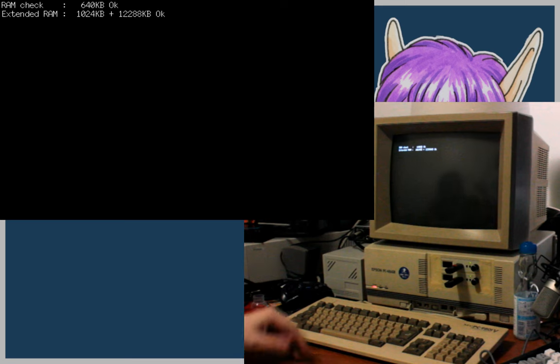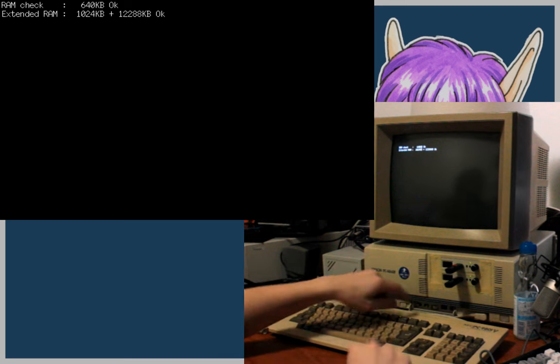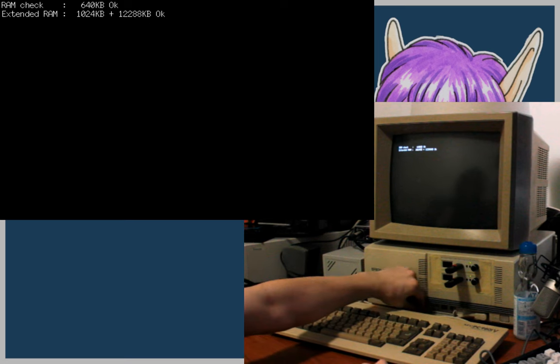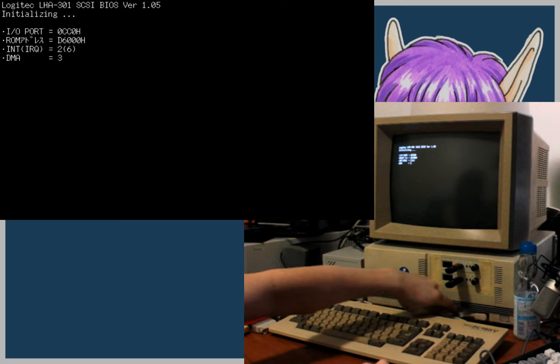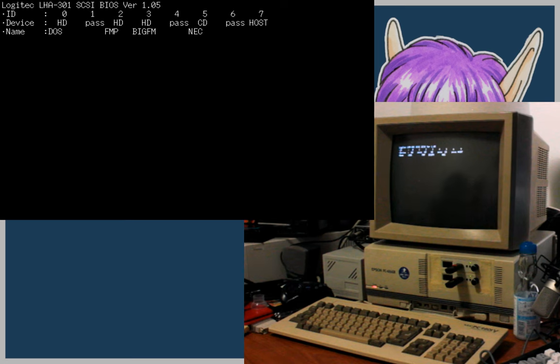Oh, another thing to mention, the YM2203, which is the M26 sound thing, is mono only. And the line output on the Epson is in the front, so you have to have this flap open to use external speakers with it, or the line out in general. And you only get mono sound. The 86 card is stereo though, so that is another reason the 86 card is a great thing to have. Or a system with the integrated 86 card, like my friend has. She has a PC-98-21-CE2.